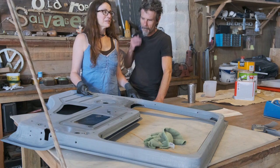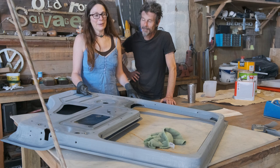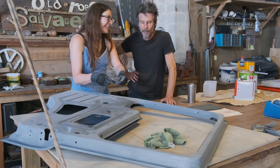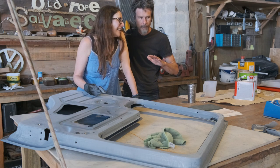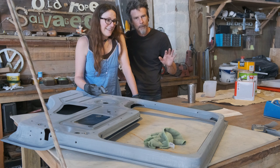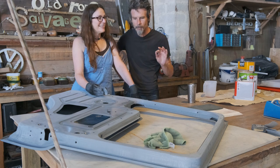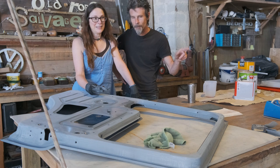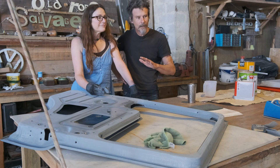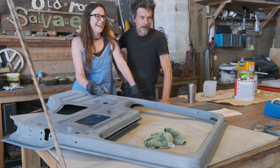It's a massive amount of progress, but from a visual point of view it must just look like 50 shades of grey forever. For me, it's just like — oh, it's still grey. With the high-build primer, some of them only need sanding down a bit, but some I want to spend more time on to get out the last little bits of ripple. The high-build primer sounds really nice — it doesn't clog up the paper, it's a bit softer, and wet-sands really nicely. The epoxy primer is definitely a bit harder to sand, but better now that the weather's improved and it's properly dry.